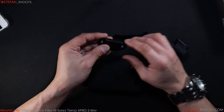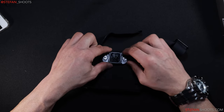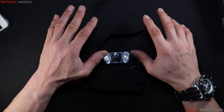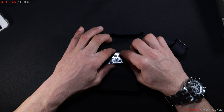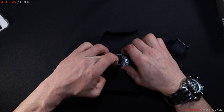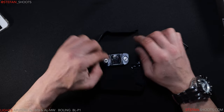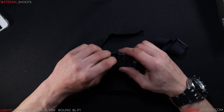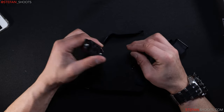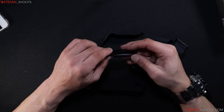Let me go over the battery real quick. This takes a CR2032 battery. If you do need to replace it, I would recommend getting a nice tablecloth — make sure it's white or a different color than black, because these screws are really easy to lose. Make sure you put everything back exactly how you find it. If you put the battery in at an angle, it doesn't work because of the connections. These are the connections right over here. When I put on my brand new heart rate monitor, it connected right away — to the 830 and also to the 1030 that I just received.